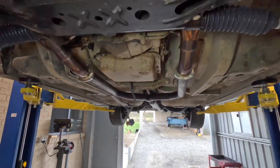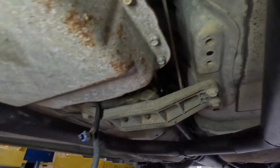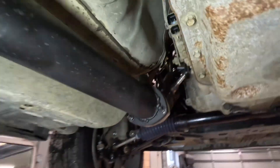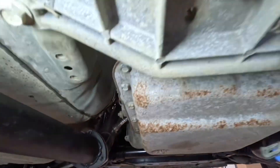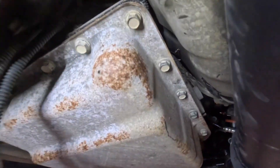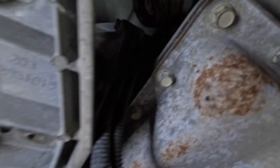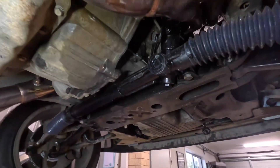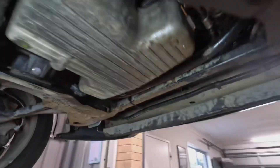All of that stuff is undone and everything's unplugged from the auto as well. You've got two plugs on the inhibitor switch back there, the speedo sensor on the back of the transmission, and there's also a big round plug that sits up on the side. The seal's leaking again - that's a shame. Anyway, we'll drop it back down now and pull all of that wiring through.